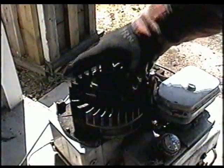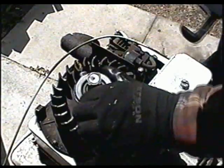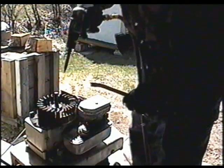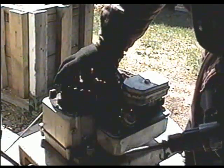The rope in there is going to provide a lock so that I can remove this part here. I'm going to remove that with a pipe wrench, just like that. Make sure you don't grab on the little screw holes here because that might break. To remove the flywheel I've got my air hammer and a pry bar. I'm just going to insert the air hammer here and then pry up a bit at a time, not too hard, and the flywheel should come off.